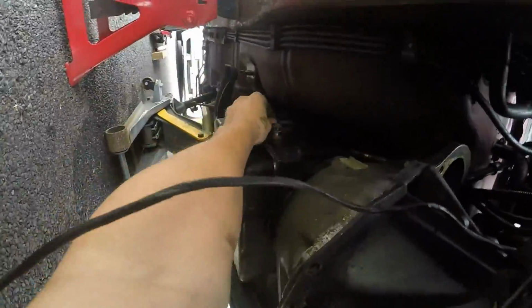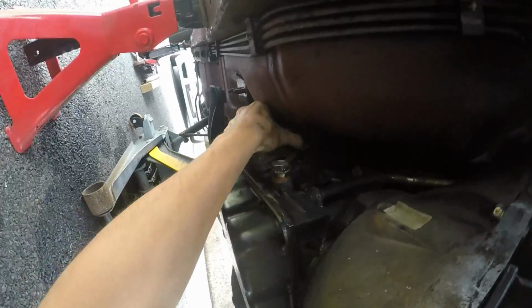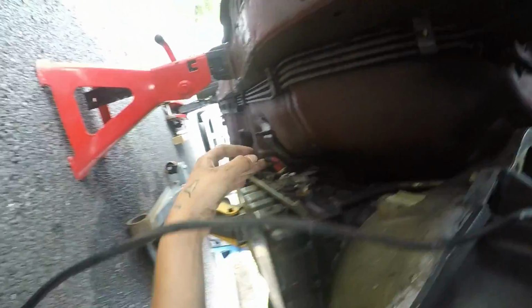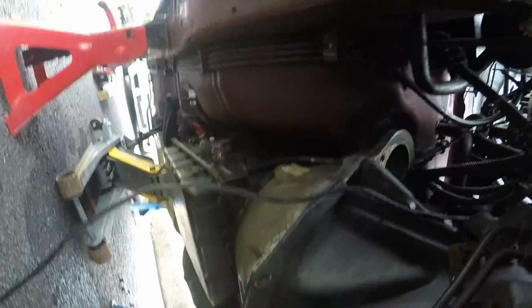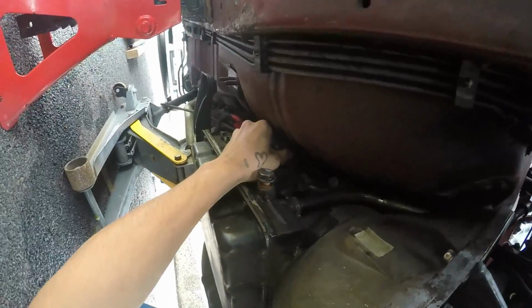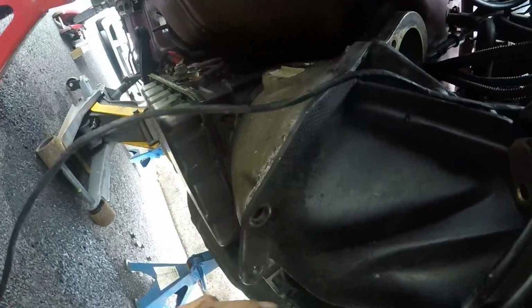So there's two easy ways you can jam up the motor. First is you just put your gearbox into gear. Now we've got the linkages off, so you just do this. That's first. That's park. So you put your park brake on, and then you try to undo these bolts when you have to spin the motor at the front. So obviously we can't spin the motor now because it's in park, so we have to go park, reverse, neutral. Then we spin the motor from the front.